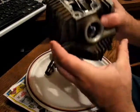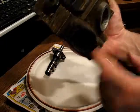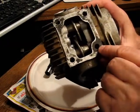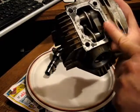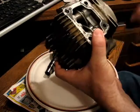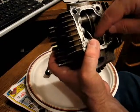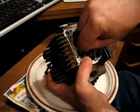And that's the hole for it. This is the bottom of the head — there's the exhaust port — so it comes down through here. There is a hole inside there, and the stud is sealed so it doesn't allow the oil pressure to come out. But the rocker shafts are hollow. So there's a hole there to feed the oil into the rocker shaft, and there's a hole in the rocker shaft to feed that rocker.